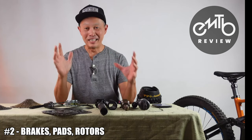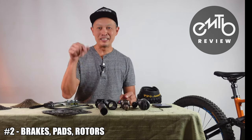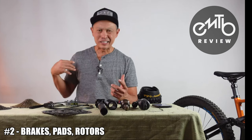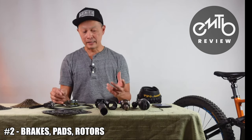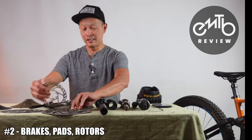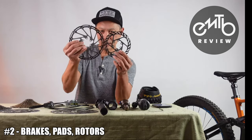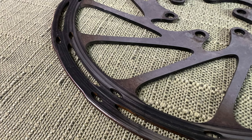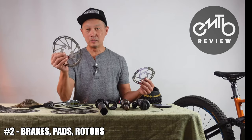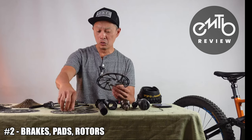The second most important upgrade is your brake system. Brakes are even more essential on e-bikes than normal bikes because the bikes are heavier — about 20 pounds heavier, which feels like 30 pounds on your body — and you go much higher and further on these bikes. My old rotor on my Look carbon bike was plenty, but my Levo came with a 180mm rotor and it was torched — so discolored from heat — just from doing different rides. The bike is much harder on brakes.